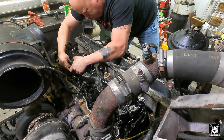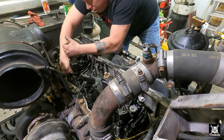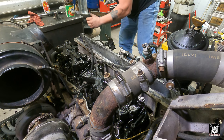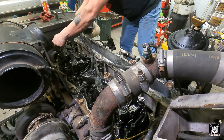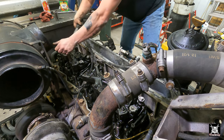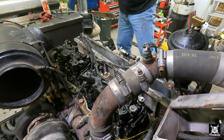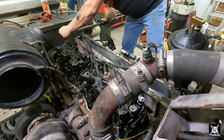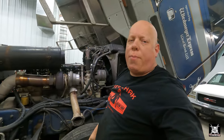Spacer. Again, 50 pounds. Readjust the torque wrench to 100 foot-pounds. Jakes are installed. Alrighty, Jake brakes are installed, but not adjusted.